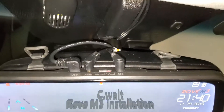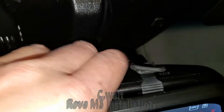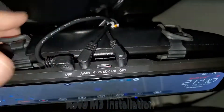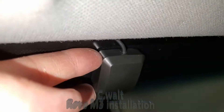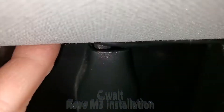Okay, this is the second part. I'll show you what I've done here. I went ahead and ran the power — I used a clip. My mirror has already got a power clip and it helps hold the cable in place for the existing mirror. So I used that to hold the wires down. You'll see the GPS is plugged in and I've got these extra wires I need to tuck under the headliner. Super easy — you just lift it up with the tool and this slides right underneath the headliner so you can tuck all of these wires in place.